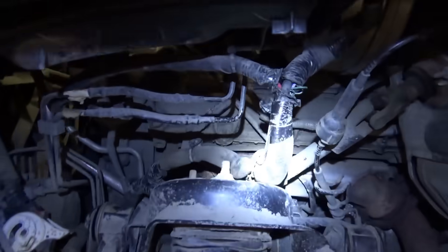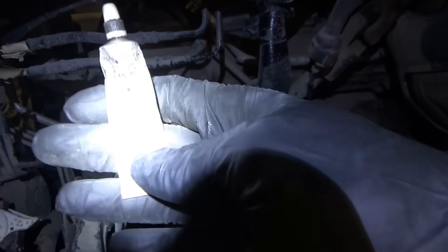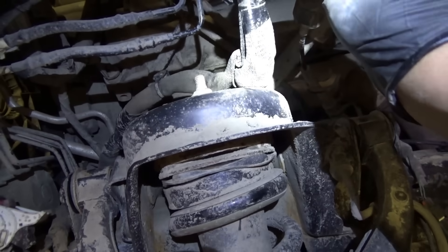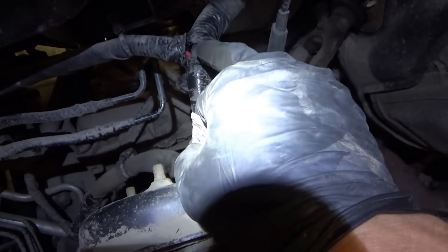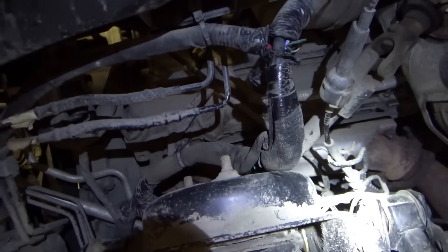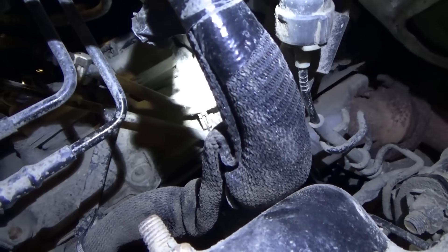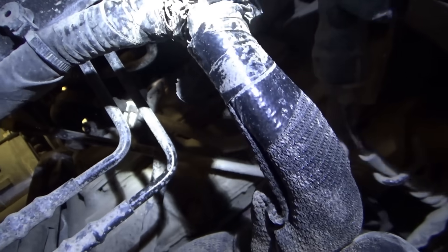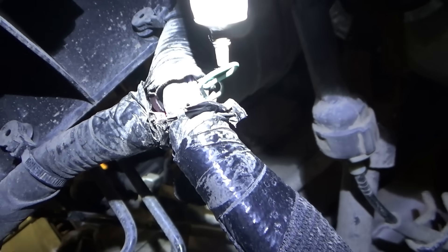People always ask in the comments what I use to seal up the little pinholes from the probes on these wires. I like to use dielectric grease or silicone paste — they fill in the little hole nicely, they stick, and they're water resistant. Liquid electrical tape I'm not a huge fan of: it's messy and when it dries it can peel off, which isn't reliable. But silicone grease does not age or harden. Find your pinhole and just put a dab of dielectric grease right there, make sure it goes into the hole.